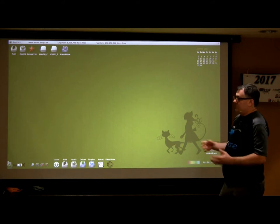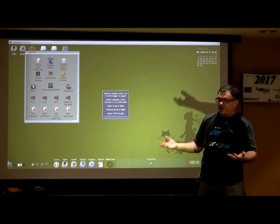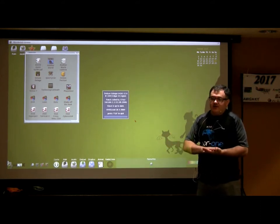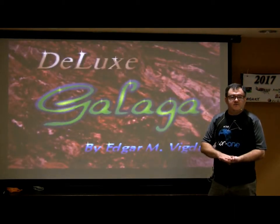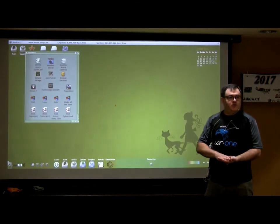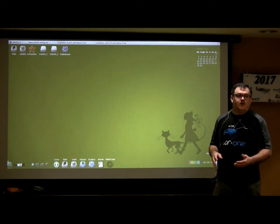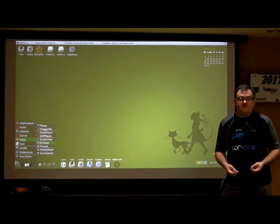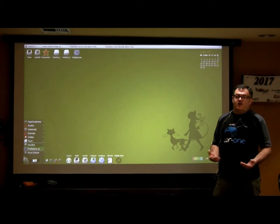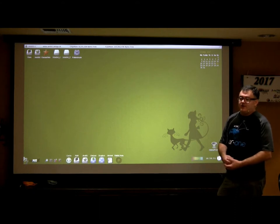All of that work is rolled up into this package, and in addition to the base hardware configuration, every Amikit laptop that we touch and create has at least a 256 gig SSD out of the box. So we replace the factory default slow rotational hard drives that come with these machines. It creates a far better experience, far better boot times, and it really does go a long way to making things feel snappy. The cost of 256 gig SSDs is such now that they're basically the smallest SSD you can buy in volume, and they're not terribly expensive anymore.